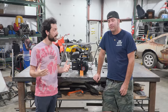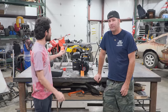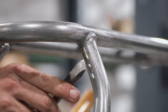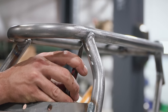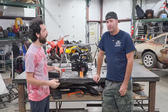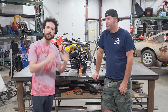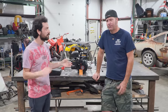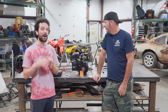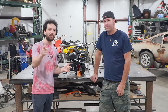It is an assemble it yourself kit, so it's always a good idea once you get it out of the box to just go over the frame and feel out any imperfections, burrs, sharp spots in the chassis, and either use a punch to deburr it or sandpaper. Yeah, sandpaper, angle grinder, anything you need to just smooth anything out. This one in particular was pretty nice. We had 5 minutes of total going over it, if even. So now we're going to test assemble it, make sure everything fits, and then go on to painting. We'll be riding in no time.